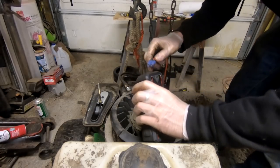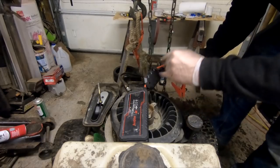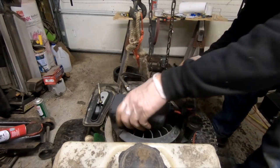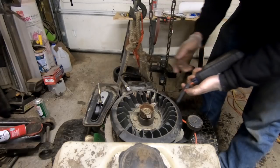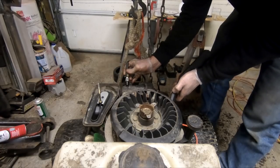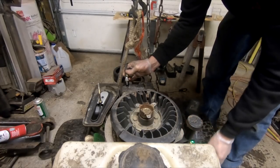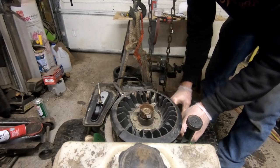So at this point we're going to get out our trusted ADU. I really love this thing, and you should check it out in the link in the description. As you can see, it's been well used, but it has a manual kickover button on it. I'll hook it right up directly to the starter, and hook the other side right directly up to the inside edge of the starter, and nothing's going to happen until I hold down this little red button here — and then we'll see if we can get some spark out of it. That's not good — that starter is not moving and is making really bad noises. I guess we're going to rip a starter apart next.